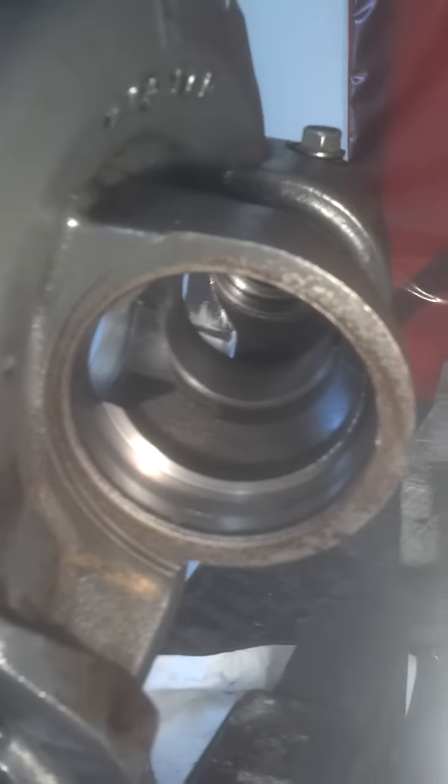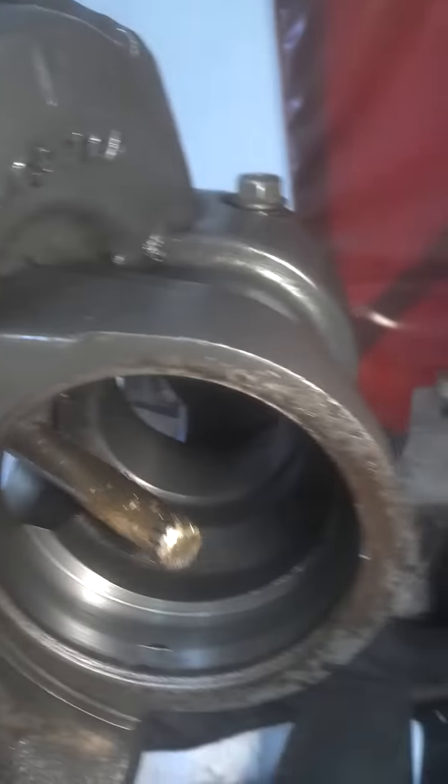A word to the wise: when you take these out and remove that seal, you've got to get that large bearing out and clean the accumulated rust that's built up from moisture right around this lip. It's not easy to drive out, but it's not hard either. You've got to get a brass drift so you don't damage your races or your case, and you come in from a couple of angles, tapping it out real careful. Clean that rust out first, and you'll have it apart.